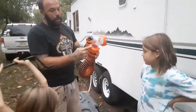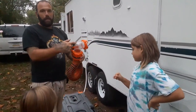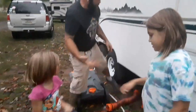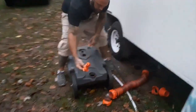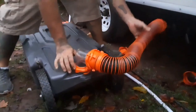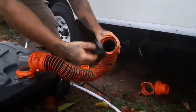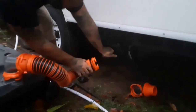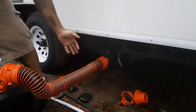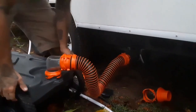You use the clear hose when draining so you can look into your tank and see when the level is getting close to being filled. You open up your fill reservoir, put your 90-degree elbow on - it clicks in place - and then you take your fill cap out and swap it on right away. Notice I haven't had to touch anything that actually has fecal matter on it.